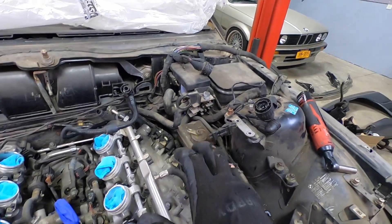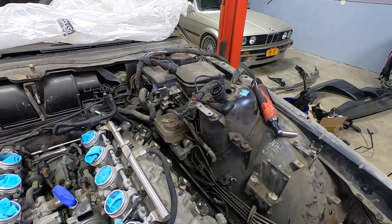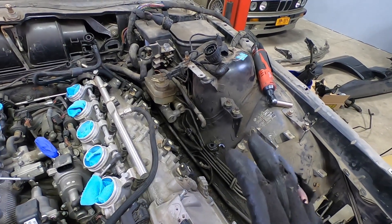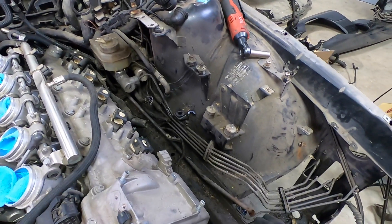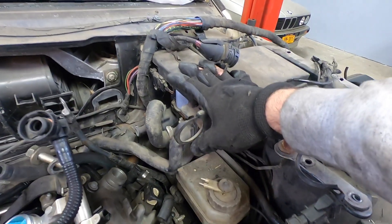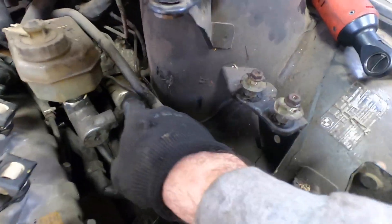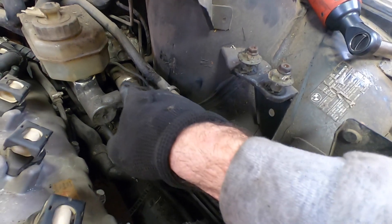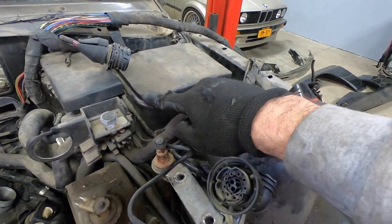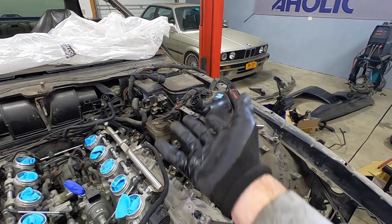I have no idea how expensive it would be to have a BMW tech remove this system if you took your 8 Series in and had your Hydro Pump replaced — I cannot imagine the cost, but it is going to be expensive. It's taken a while to get all this stuff out. The reservoir has six different connections that I removed. I've got to continue taking this heat recirculating pump out, then the master cylinder, and then the Hydro Boost pump right back there. I'm going to just remove everything and build this all up from the ground up again.